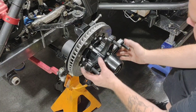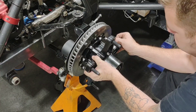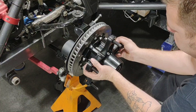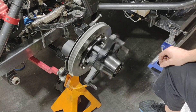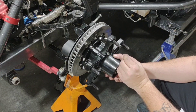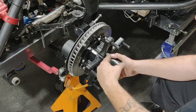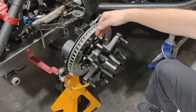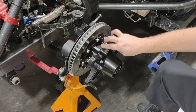I go to snug and I can feel just a tiny tiny bit of movement in it. Now when I go ahead and lock it down and tighten it, that movement is gone and it's still free. That's a perfect bearing setup. Now when I go ahead and put oil in it, or if you grease it, that little bit of material in those bearings will create a coating and tighten that up just a hair, taking any movement out of it at all. So now I can disassemble it, lock down my bearing spacer, put my seal in the back, my snap ring, finish this hub up, and I know that this bearing spacer is absolutely perfect.